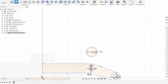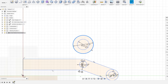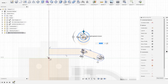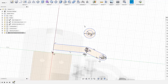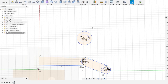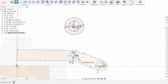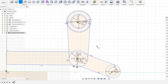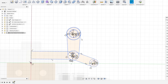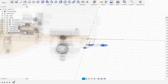Having a small rack and pinion setup that I could simply mount somewhere in front of the lower control arms would be awesome, though beyond the challenge of building a functioning rack and pinion so small, I'm sure it would come with its own set of compromises and shortcomings. Instead, I sketched out a few different ideas on paper and brainstormed different approaches. I came up with a number of configurations and decided to start with the one that positions the steering arms and center link out in front of the motor.